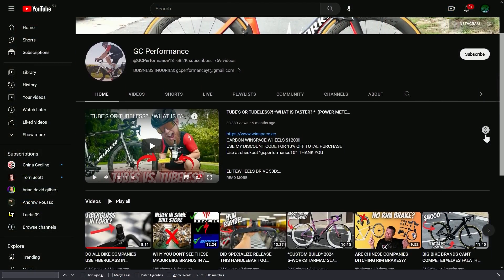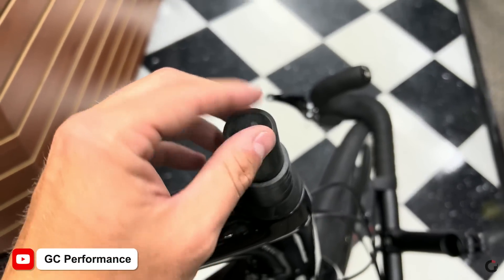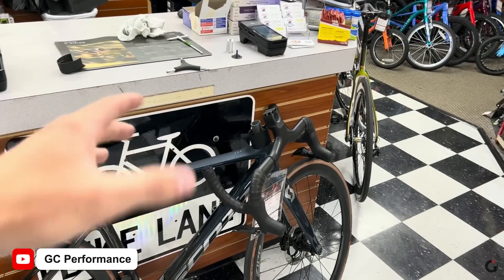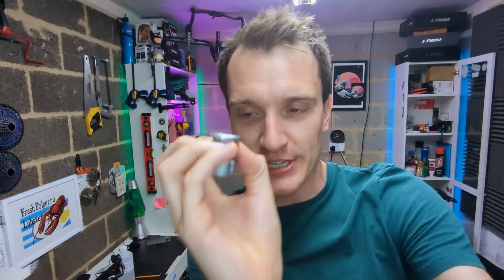Shout out to GC Performance - another great YouTuber who was looking into this recently, and it appears to back this up. He took apart some pretty premium frames from the likes of Specialized and Scott, and they had glass fiber inside their carbon steerer tubes. I wouldn't worry too much though. I think, to mirror what quite a lot of people have already said, it's probably there to limit galvanic corrosion. In a carbon steerer tube you tend to have an aluminium compression plug, and if water gets between carbon and aluminium it can act a bit like a battery and essentially corrode the two together. If you're not hot on your maintenance, these can be almost impossible to remove, so I presume that's why the glass fiber is there - and it seems to be reserved for the slightly more premium frames.